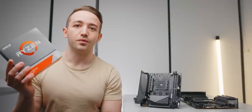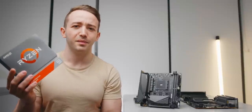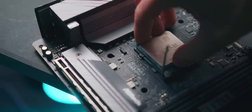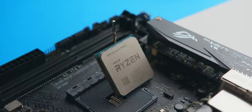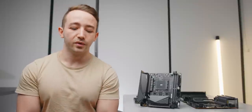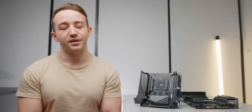Today we're testing four B550 ITX motherboards to see which one is the best for your AMD Ryzen system. We're testing them with a 16-core Ryzen 3950X, analyzing VRM and CPU thermals as well as CPU boost clocks. Overall you've got some really good choices if you're planning your next ITX gaming PC build with a third or fourth gen Ryzen processor, however there are some big differences between them that you should definitely know about.